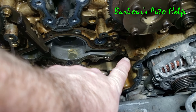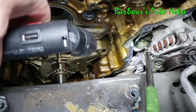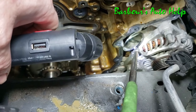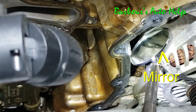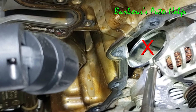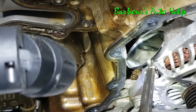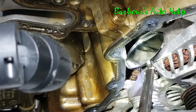You see your alternator right there — it weeps out just behind the alternator. That channel exits out the side of the block. It looks like a freeze plug right there, but it has a little opening at the top — that's the weep hole that allows the coolant to come outside the engine, and like I said, it leaks right behind the alternator.